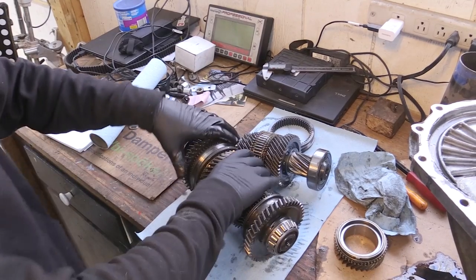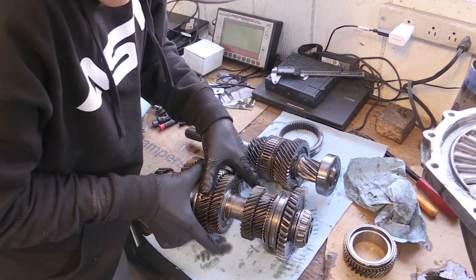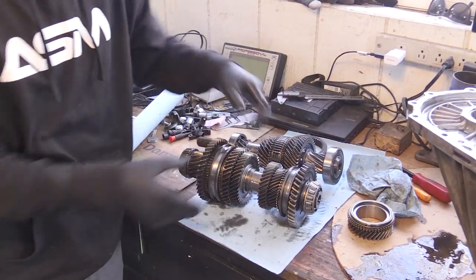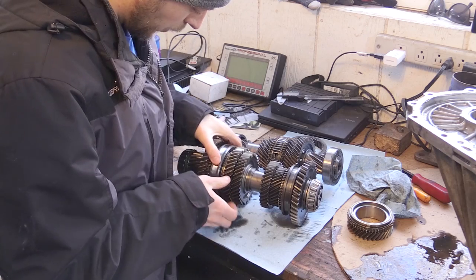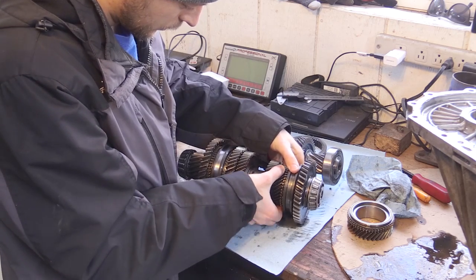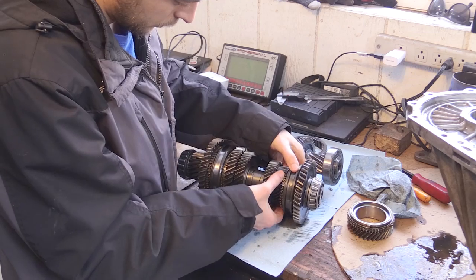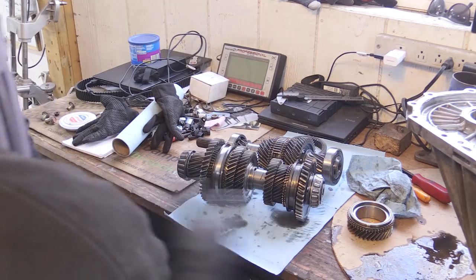So I'm actually putting quite a bit of pressure on 5th gear right now and I'm still able to spin it — I shouldn't be able to spin it by hand. Now watch second gear. I can't spin it when I apply pressure. If I let go, I can spin it freely. But with pressure, you just need a little bit and it locks. Second is actually a double synchro. With a good synchro, you shouldn't be able to turn it at all under pressure — and you can see this one locks immediately. It didn't quite bottom out, but you'll sometimes see a synchro completely bottom out and contact the gear.